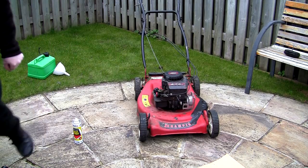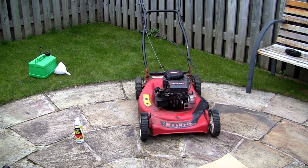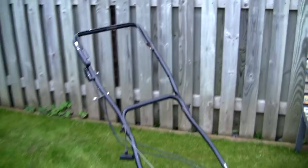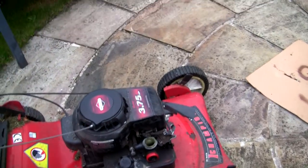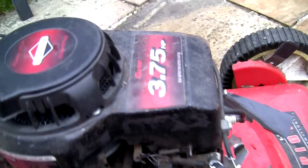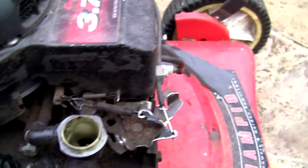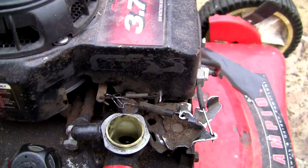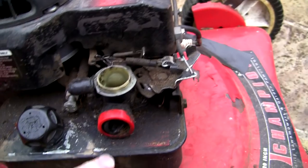There we go — one perfectly running Briggs & Stratton petrol lawnmower, free of charge. This is great! The problem with doing that with the handle taped is you can't stop this lawnmower. I'm not suggesting you do this, but if you just put your foot over here it chokes it so much that it'll stop. The way I got that going — I sprayed some Easy Start in the spark plug hole, that didn't work, so I tipped some in here and tipped the lawnmower up slightly to let quick start go down. I bet no one's started that for ages.